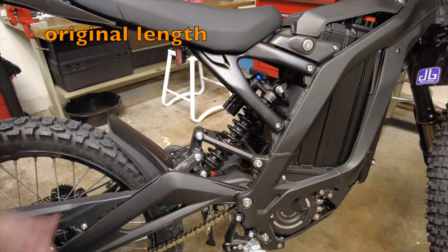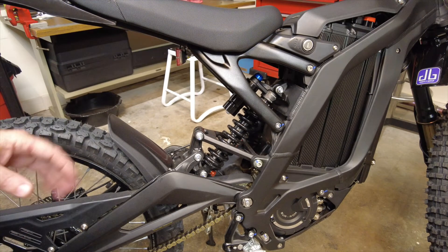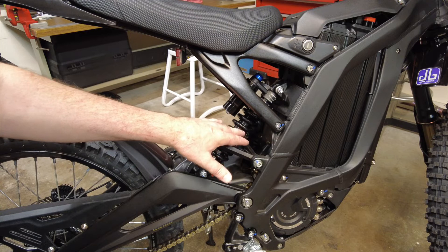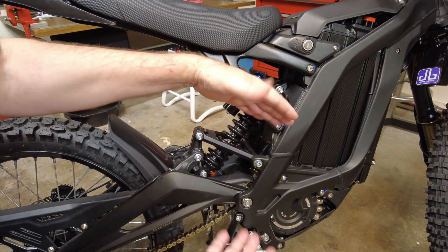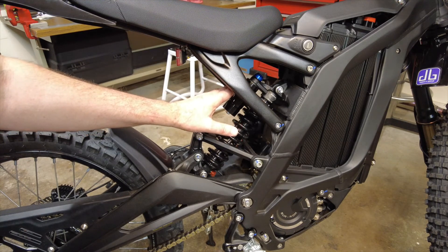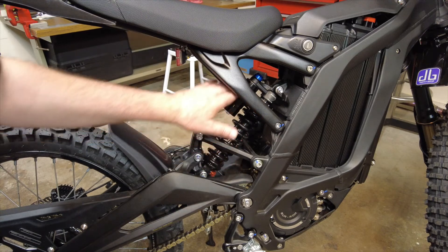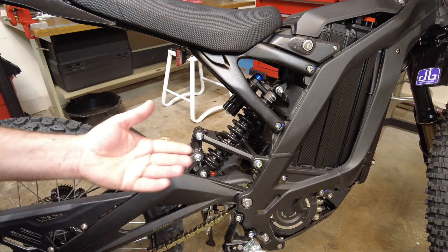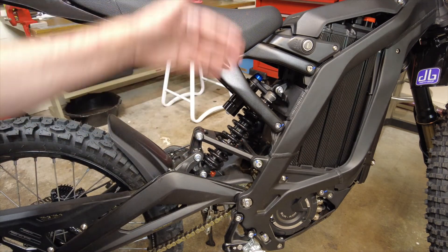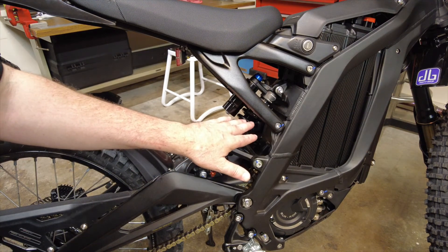Hopefully that helps someone. Before you go looking for a bigger, stiffer spring — just so you know, if you put on a much thicker, harder-to-compress spring than the factory one, you typically have to revalve the shock, because the shock should be valved for the original spring tension. Going to a much heavier spring can throw things out of whack. That's just general motocross suspension education. Hopefully this helps someone tune their suspension on the 2022 Surron X Black Edition with the FastAce rear shock and forks.